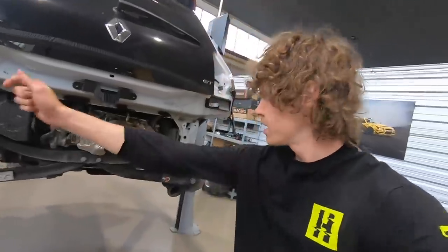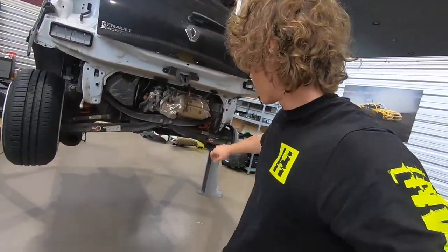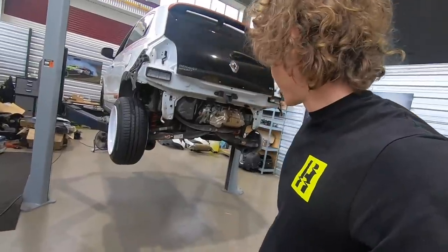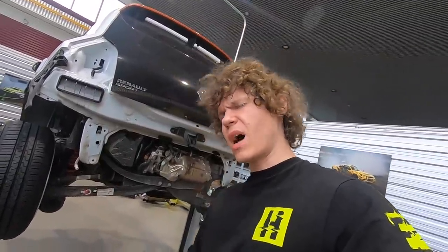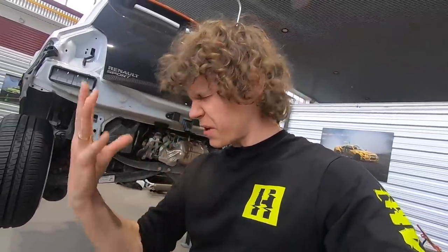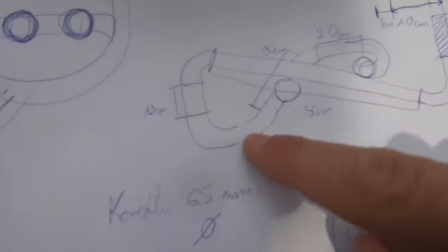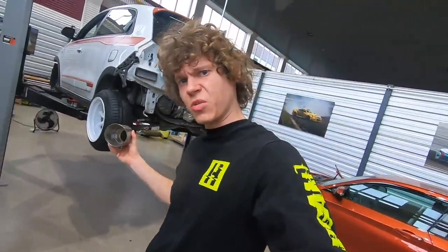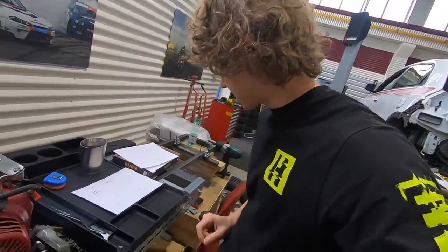It's not actually too loud when just the catalytic converter is left on. So what I figured out is I should do just some pipes and that's it — without any muffler — because it shouldn't be too loud. But the question is how those pipes should go and what routing will work perfectly for Twingo power and acceleration. I have these lovely exhaust pipes from Arc Performance, probably designed for the GTR, so this will be perfectly matched to our GT without the R. They are 10 centimeters in diameter — perfect size.